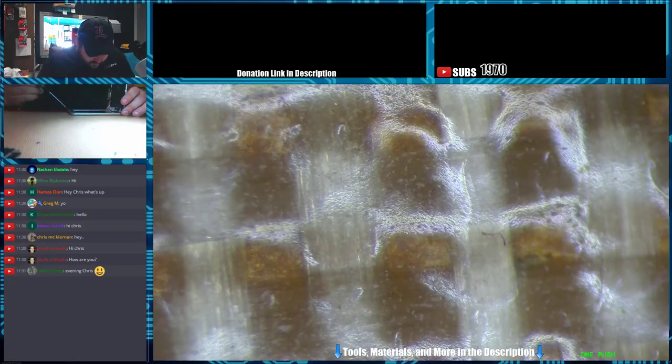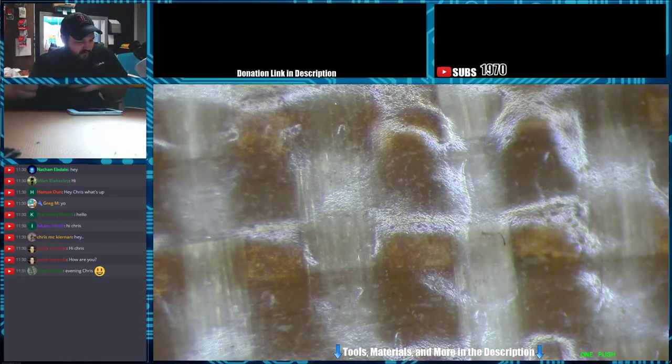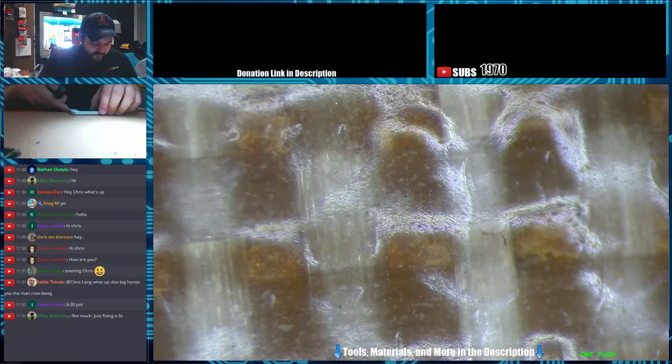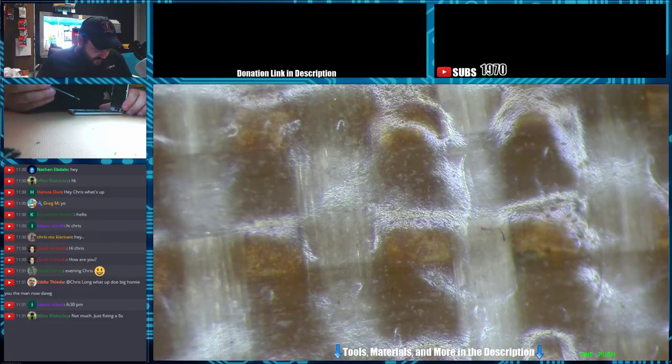Alright, so looks like we got all the screws out. This is an iPod Touch. I believe it's a 6th gen. Pretty sure it is, because the home button's not made onto the shielding. On the 5th gens, there's a piece that goes across here that the home button sits on. On the 6th gens, I'm pretty sure they went to this style, where the home button is actually mounted on top of the charging port.